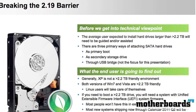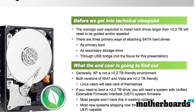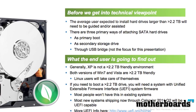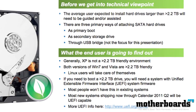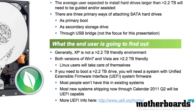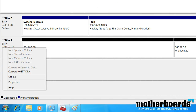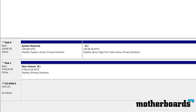A quick note again on breaking the 2.19TB barrier: this product is not planned for Windows XP support. Vista and Windows 7 32-bit versions are supported as secondary storage only. Vista and Windows 7 64-bit versions support boot capability where UEFI is supported by the motherboard, or by using the included adapter card. The latest Apple OS versions and most current Linux distributions are fully compatible, meaning you can use this as a boot drive in those systems. One thing to note: in order to format the drive properly, you will need to use a GUID partition table, otherwise the drive will not be recognized in its full capacity.